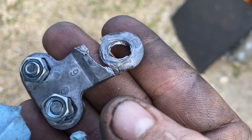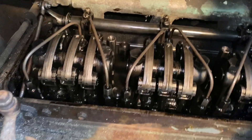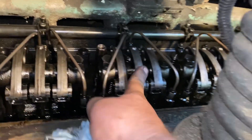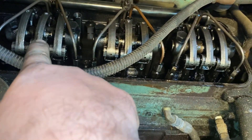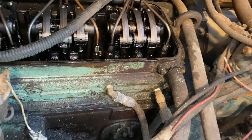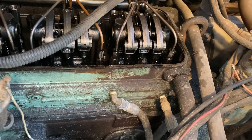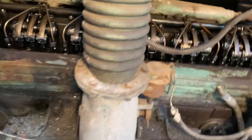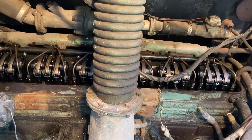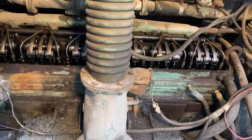I found this terminal broken off in there — it was just barely touching and I think that was where all that resistance was coming from. We're going to replace this; it's on an on/off switch. This injector here has no label, no tag. This one has no tag. This one's an N55. This one has no tag. This one's an N55 and this one's an N60. So I know there are two different sizes in here for sure, which isn't going to let it run really well. The ones with no tags — who knows what they are. It's never going to run right with different injectors in there.